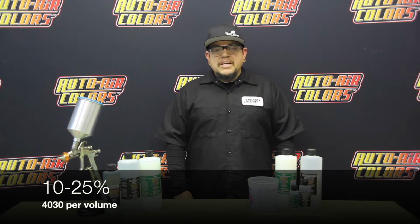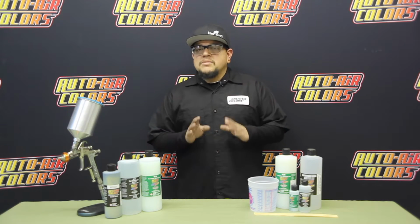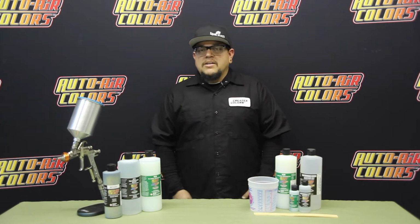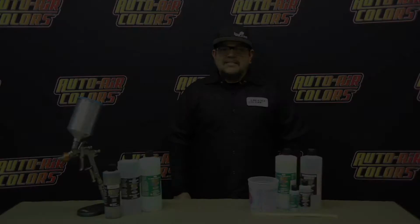By adding 4030 in to your favorite Createx color, what you're doing is creating an acrylic urethane paint. What this means is it's going to handle and perform a lot more like an automotive acrylic urethane paint. This means ease of sprayability through your spray guns. Now let me give you an example of mixing.